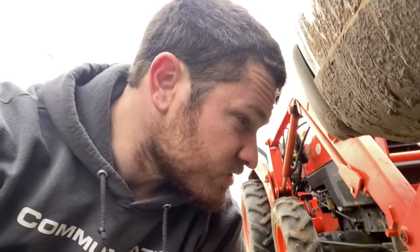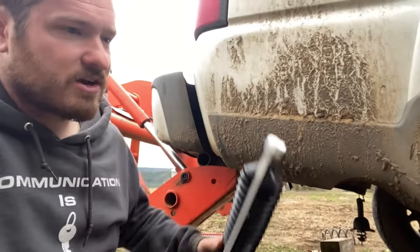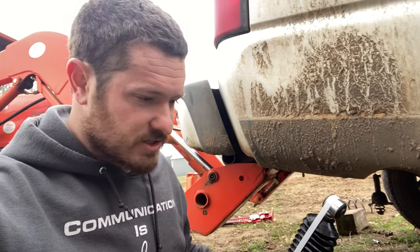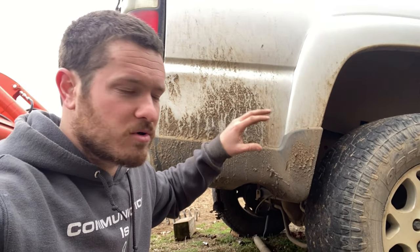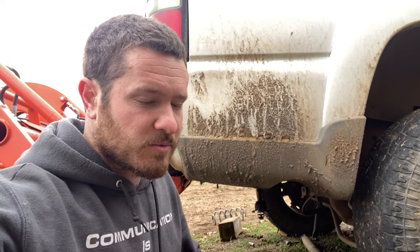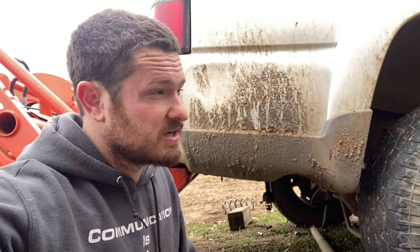The dangerous part is over — springs are in. Actually looking pretty compressed, I'm a little bit surprised. Time to get some more of this stuff bolted back up. We're going to change out the shocks to some slightly longer ones from Bilstein. Hopefully this will lift it a little bit and make the suspension a little bit firmer so we get a little bit less body roll. It's not an issue, but I am trying to alter the suspension — it works really good off-road, but on-road it's a little bit soft. We'll get the rest bolted back up and see where she sits.